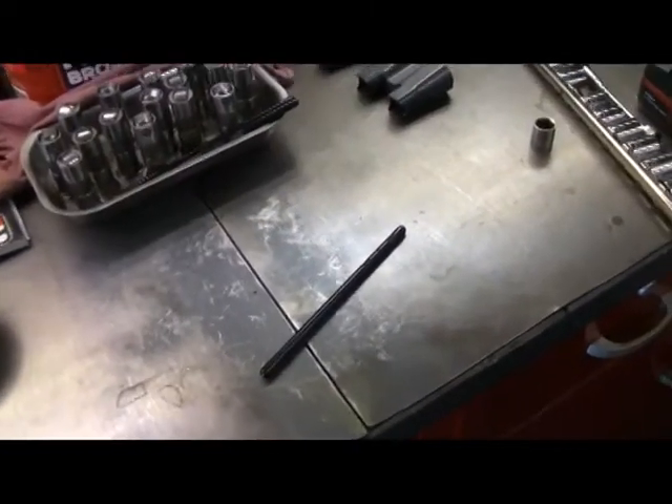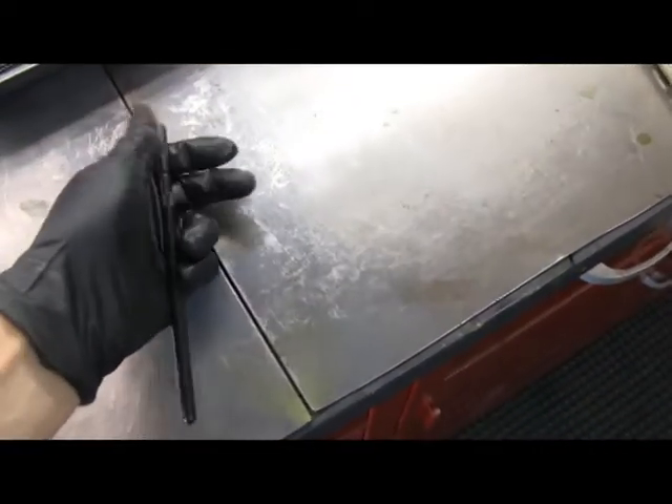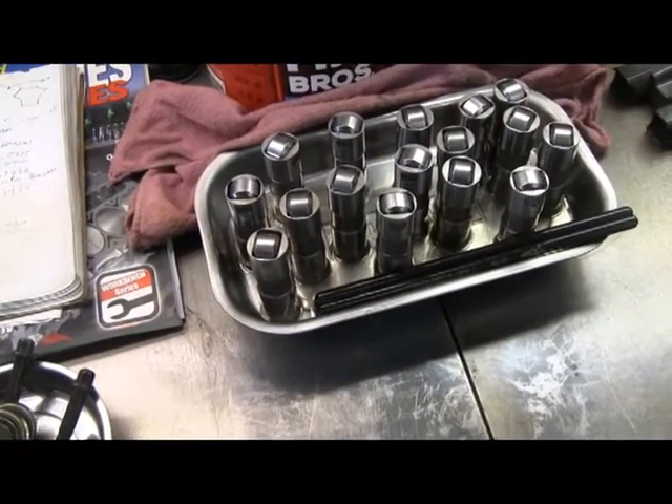To be able to check both of these things, you need a couple of tools. One is this here, which is an adjustable pushrod. You can see it's in two pieces and this end screws off — you can see how it gets longer. So you can adjust the length of this thing. And the other thing you need is a solid lifter. I'll show you how to make one of those out of an old lifter.